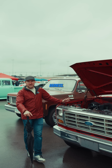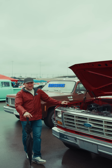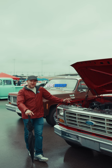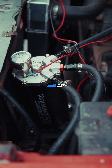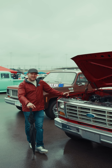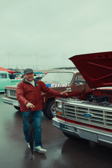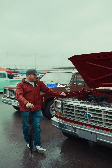It literally took out the whole harness — the ECU and everything came off the truck. It is not emissions regulated because we're in Tennessee, not California. It's about a four-wire hookup. I was able to keep the mechanical fuel pump; it went with the command center to a surge tank. I also swapped to an HEI distributor, which was part of getting rid of the Ford ECU.